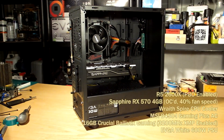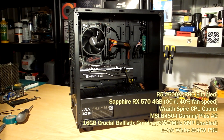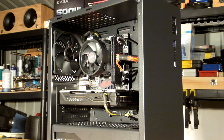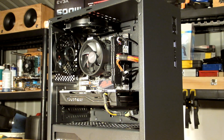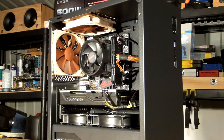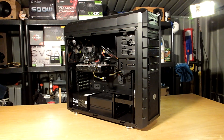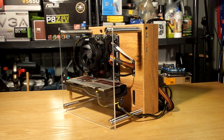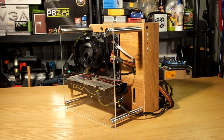So let's do a few tests. This isn't GamersNexus accurate and the methodology isn't perfect, but hopefully it paints a picture. Our test system includes a stock Ryzen 5 2600X with Precision Boost enabled on a copper Wraith Spire cooler, and an overclocked Sapphire RX 570 at 40% fan speed. We're testing four parameters: stock config with rear exhaust, two cheap Cooler Master fans as top and rear exhaust, two Noctua NF-P12s as pressure-optimized fans, and all spaces filled with both Cooler Master and Noctua fans. Comparison cases include the Cooler Master HAF XM mid-tower with a 200mm front intake, and a DIY Core P3S — once with the side panel on and once with it off.